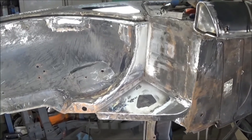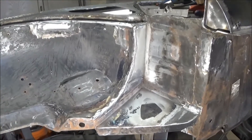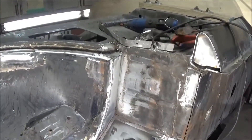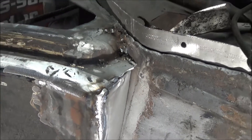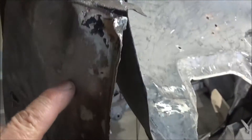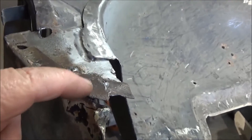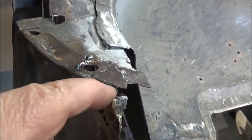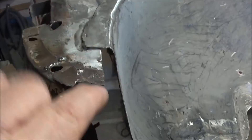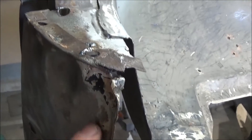Welcome back — Saturday March 24th, just about 1:30 in the afternoon. Picking up where we left off and we're going to continue to move towards the front of the car. That looks pretty good in that area now — I need a little bit of grinding up in this area here, so we'll probably do that first. The next area we're going to look at is this little area at the front here, where we've got a little bit of a crack in the front valence. We're probably going to do a new flange — strip this old wrap-around flange piece off, extend the flange to the front valence, and pound it over to wrap it around this edge. This is fairly solid in the front, just a little rusty, but we'll get that cleaned up and get it ready for some bodywork.